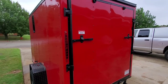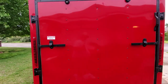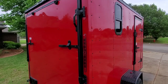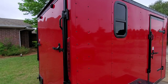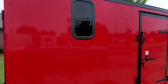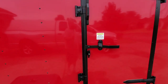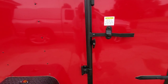There's a ramp door on the back. We did insulate the ramp door when we took everything apart and insulated it. On the passenger side we have another window. We offset the windows so that when the power vent fan is on it draws air across the trailer and pulls it all the way through. The trailer has a bar lock on it and we added a shed door handle, which is a much easier install than putting in an RV handle.